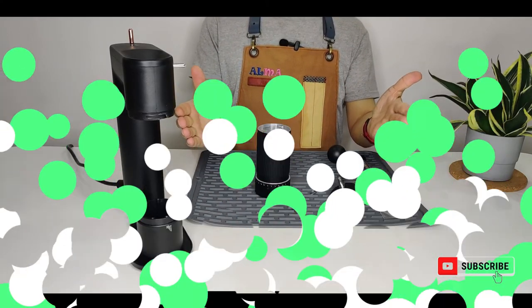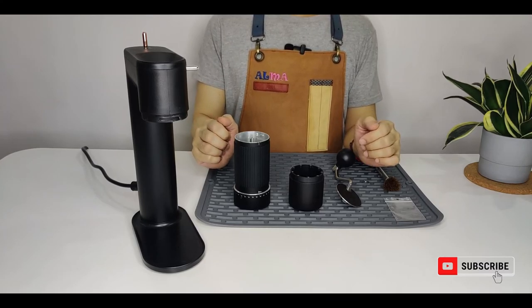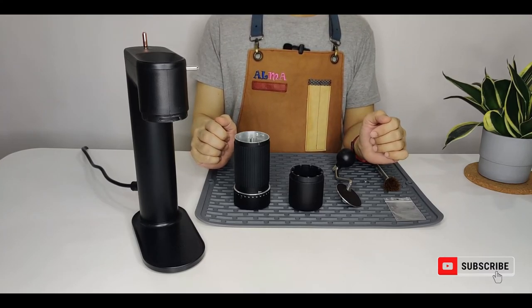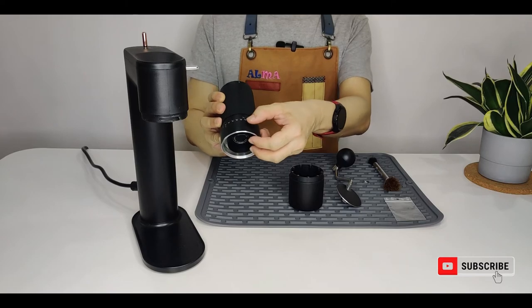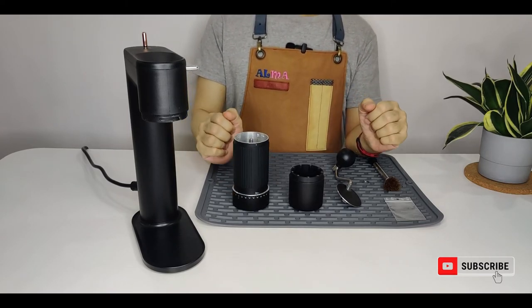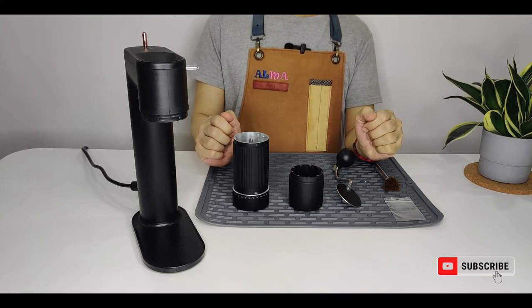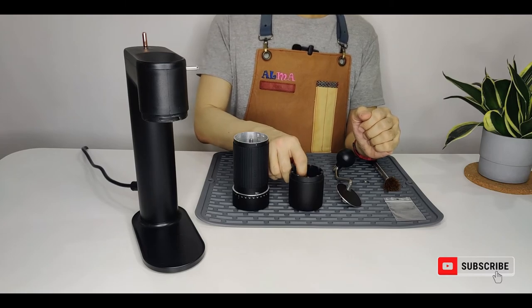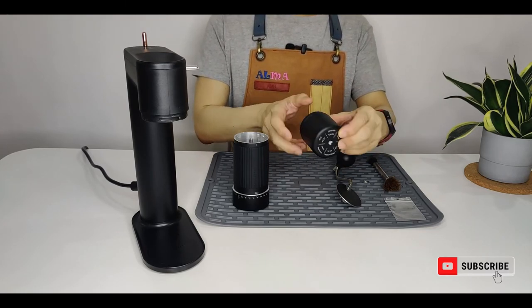Done, that's it. Our observation, with two calibration plates installed with our coffee and preferred shot timing for espresso extraction, the circular scale setting is now at 32 instead of the previous 12. We can now safely say that it is finally resolved and within the recommended grind settings of 0.30 to 0.60 for espresso.